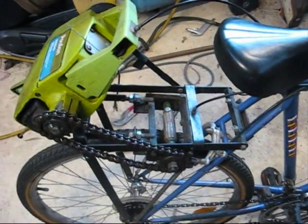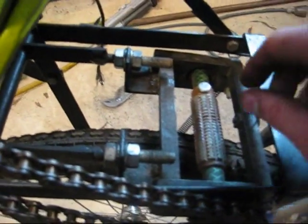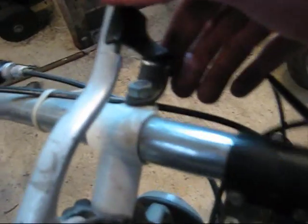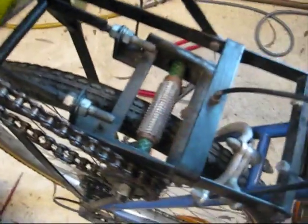Next will be the drive mechanism for his bike. It's got a spindle drive. That's a 1-inch spindle. It's actually a screw thread which has grooves cut along it with an angle grinder. Onto that is this chain here, which goes up to the engine. At present the spindle isn't actually contacting the wheel, so you can pull it and it just spins and the bike doesn't go anywhere.